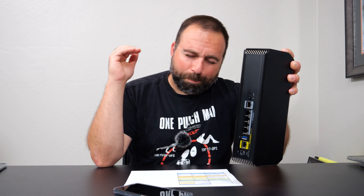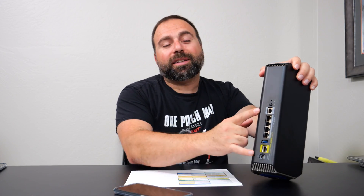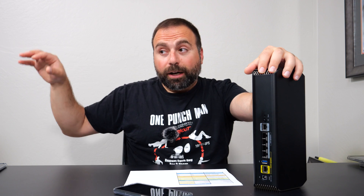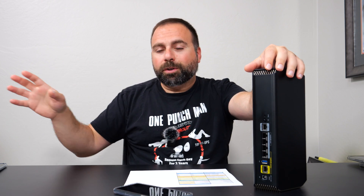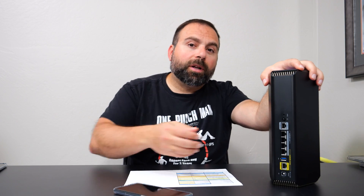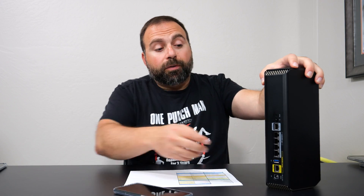To summarize, this router is an absolute beast — crazy fast. I love the performance side of this thing. I love the fact that it has two 10 gig ports. Performance routers like this should have two of the fastest available ports so you can take full use out of it. I have a Netgear 10 gig unmanaged switch and Cat 7 and Cat 8 Ethernet cable, so my home is ready for a 10 gig LAN, and I love that this router supports that. It also has a USB port for sharing a hard drive on your network, plus extra gigabit ports for regular devices. But really the main thing is the performance — especially at distance. Let me know what you think in the comments below, and smash that subscribe button.